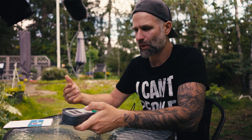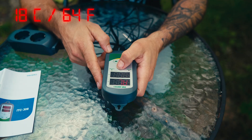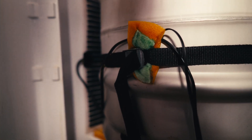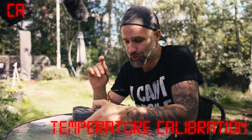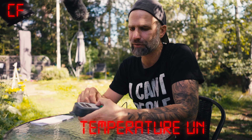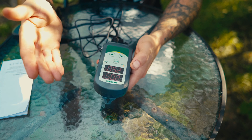If something happens to my heating mat and fermentation temperature drops under 18°C, this will start beeping. The PT setting is the compressor delay — I'll set this to 3 minutes so I don't want my fridge instantly cycling on and off, which would ruin the compressor. This gives a 3-minute lag time. The CA setting is for calibrating your probe if you find it's not accurate — I've never had a problem, but it's a good feature. And the last setting is Celsius or Fahrenheit. To exit the menu, just wait or push the button for 3 seconds.